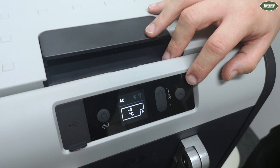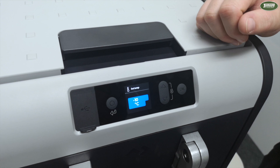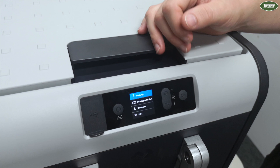In order to get to menu options, simply hit the OK button on the right-hand side and that will bring up your options. First of all you have Set Temperature, which when hitting OK will bring you into the menu. We currently have the fridge set to minus 10 degrees, however if you wanted to set that to say minus 2 degrees, you simply cycle up using the arrow keys up to minus 2, then hit OK and that will flash a couple of times before bringing you back to the previous menu.